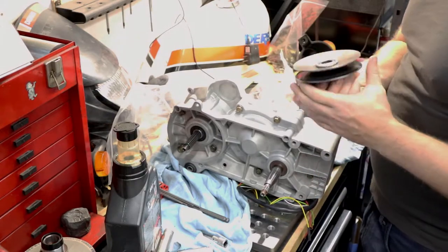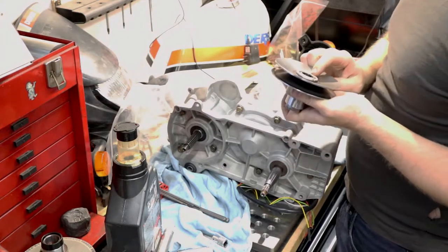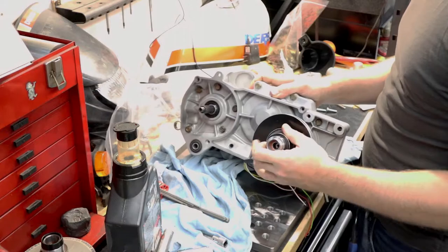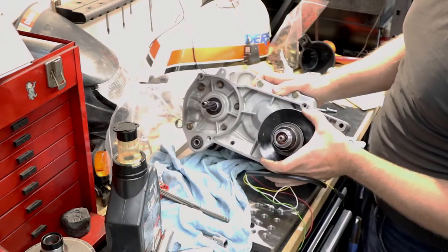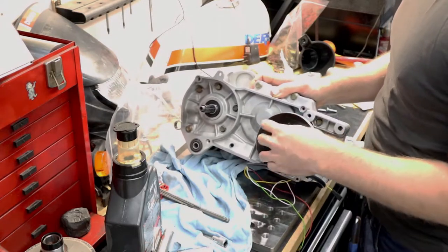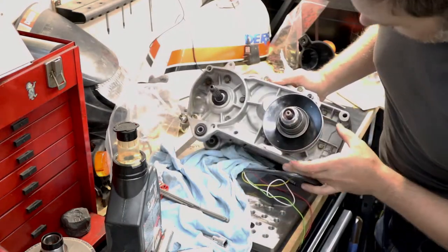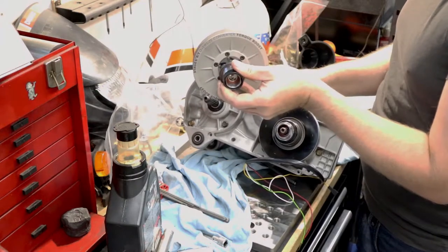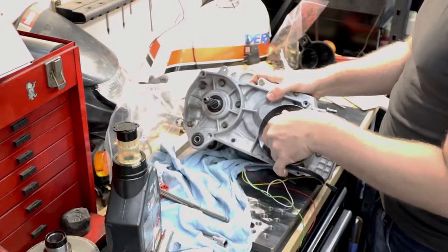With that done, one other thing I did was modify this Dio pulley to have a 2018 RS seal in the back, so it'll fit on the shaft here, just to get rid of the stock pulley. I also trimmed down the OD of the pulley halves a little bit, because the belt width on the ZX is quite a bit wider than the Dio, so this will still give more travel, it just fits in the case nicer. Eventually, I'll probably try shoving something like this in there, or maybe making new sheaves, because again, the ramp angle's a little off, so the belt could be narrower. But for now, this will work.